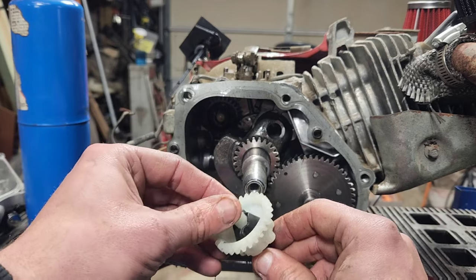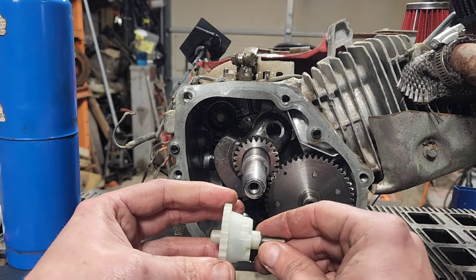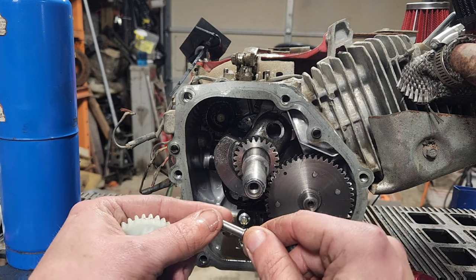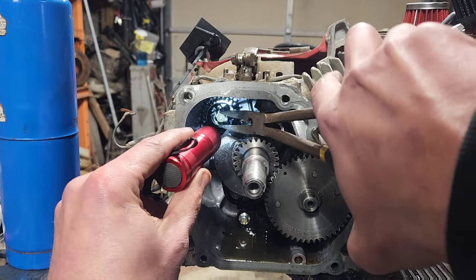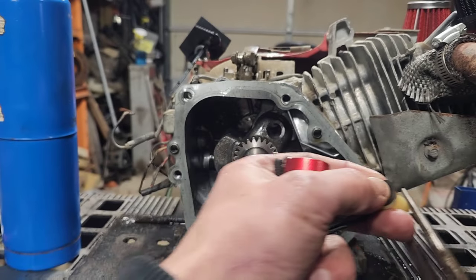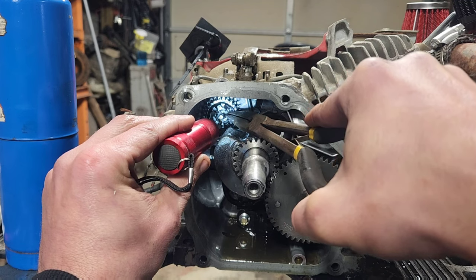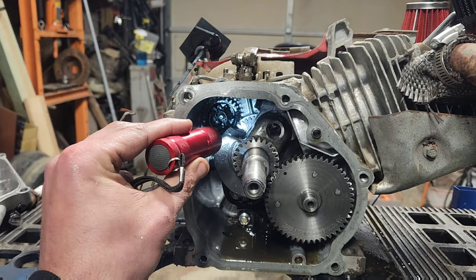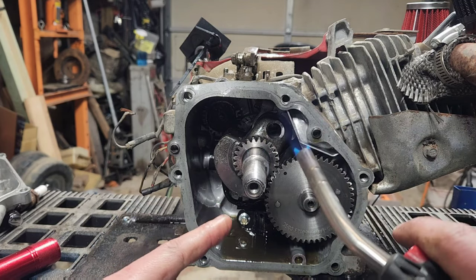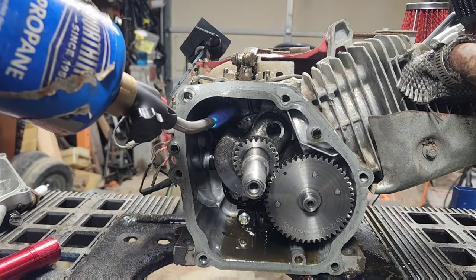In here you're going to see that we have the governor gear. What we're going to do is pull this center out, grab our blowtorch, stuff it up in there, heat this thing up, grab it with a pair of pliers, and rip it out. When we're done, there's going to be this with a hog ring on it that will never ever come off. First things first — the little center piece comes off, and with it is going to have a washer, so be careful that actually comes off. Right down in there you're going to see there's a hog ring on there. We're going to heat it up and rip everything right out of there and leave the hog ring. Now is a good time to state that if you've been having carburetor issues, this is a bad idea because that would have gas in it.